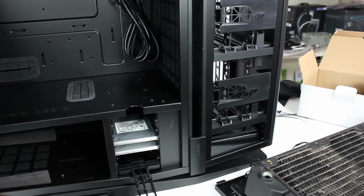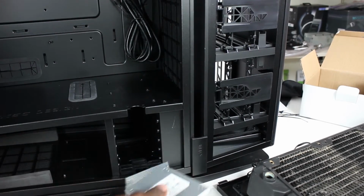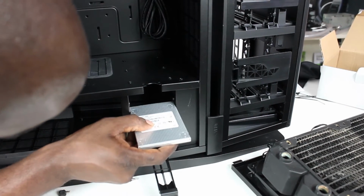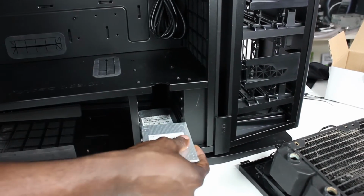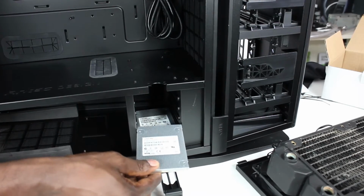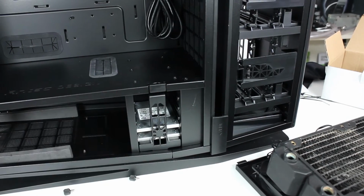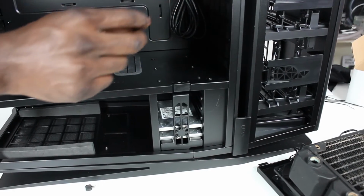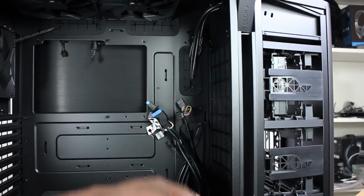Here is where you'll find your solid state drives, and you can fit in a maximum of 5, I think. 1, 2, 3, 4, 5. So you just literally slide it in. It's a very hot swappable bay. Make sure that your ends like this for the SATA connector and power connector are all in the back there, and you close it up, and your solid state drives are safe in there. And then you can screw the retention bracket on there for the fans and stuff for the radiator back onto that side there with the thumb screws, that's no problem.